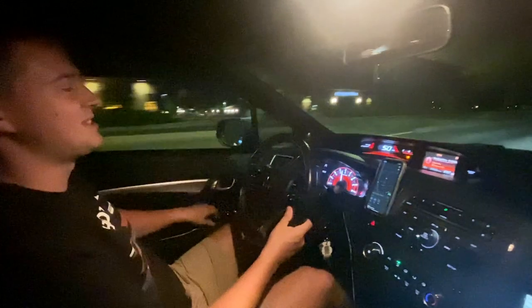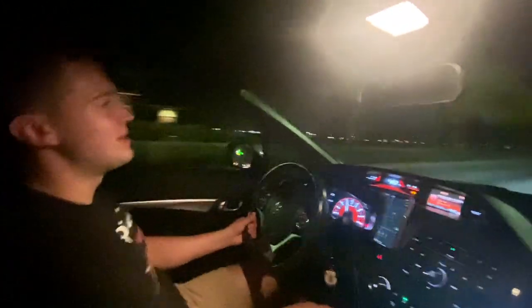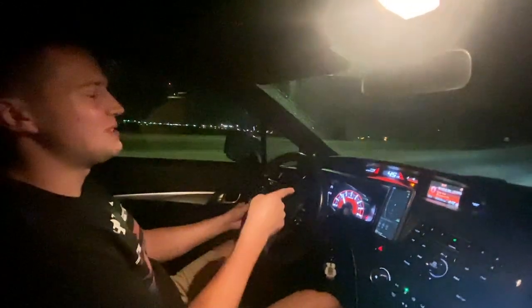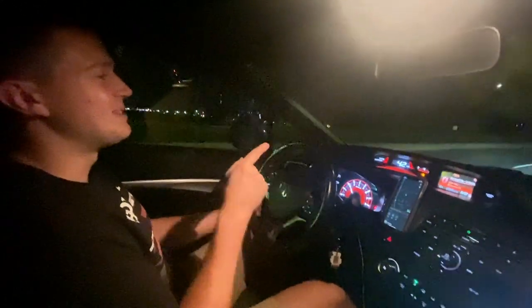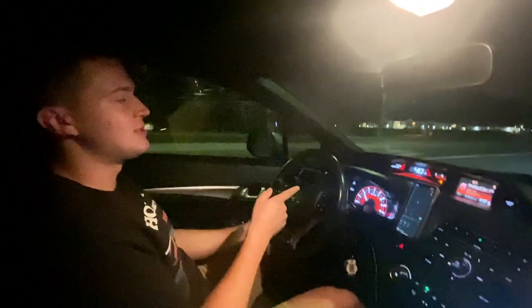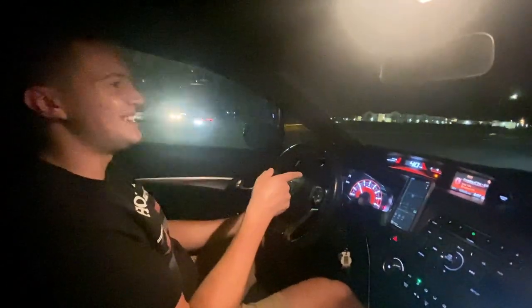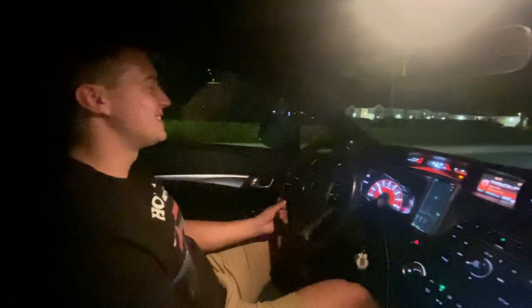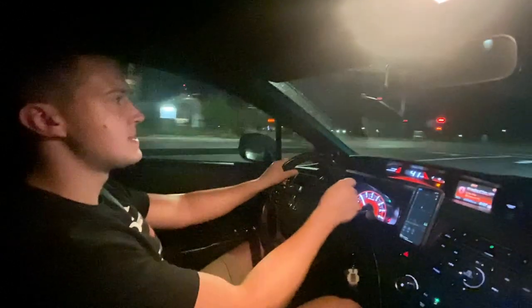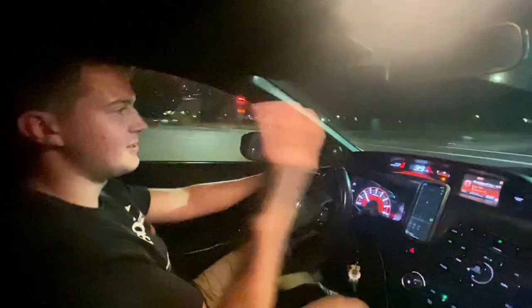All right, I just tested that out — that's how I know I'm on the calibration Josh sent me. Did you feel that? What that was: one, he turned VTEC off, so this does not have VTEC. Two, the rev limiter is set to 6,000 RPM. So I went to the limiter and it pulled us back — that was weird, but that's how we know we're on the right track. It cut the power.